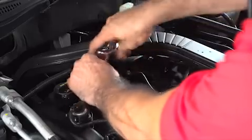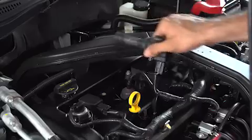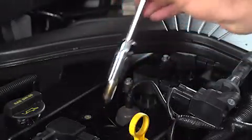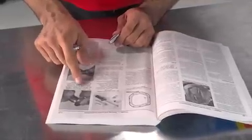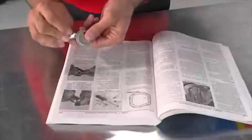When a tip is worn out, a common symptom is a misfire. It's smart maintenance to replace the plugs with every tune-up. When you replace them, it's a good idea to use plugs of the OE recommended metal or better. Look at your owner's manual or a repair manual, or ask the experts at AutoZone about the recommended plug and gap for your engine. Again, AutoZone carries a complete range, including the highest performance plugs available.